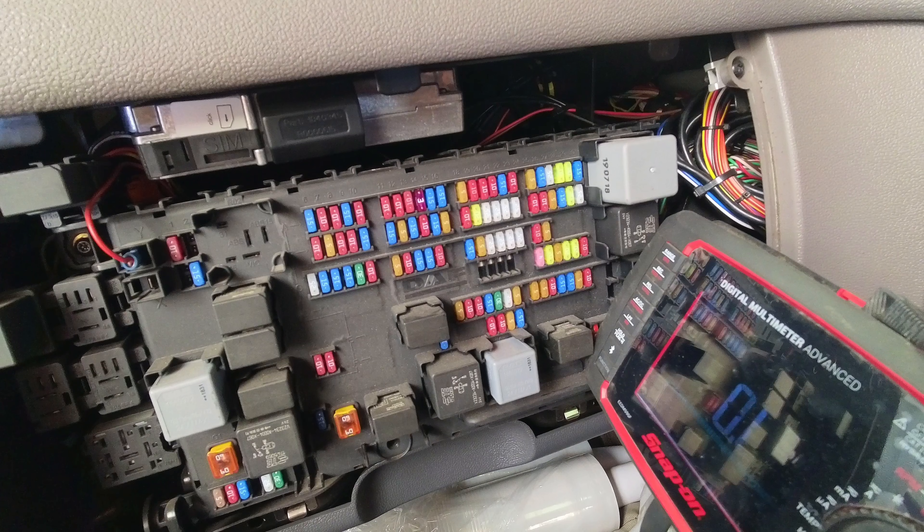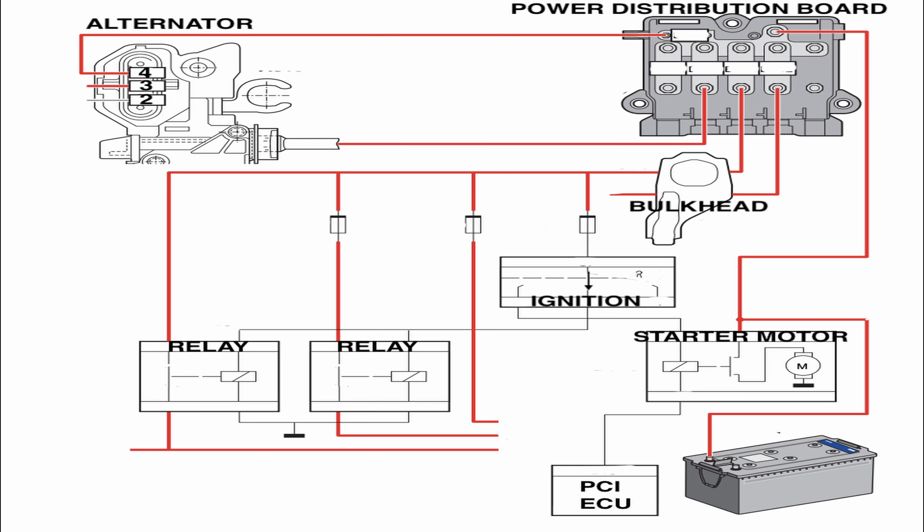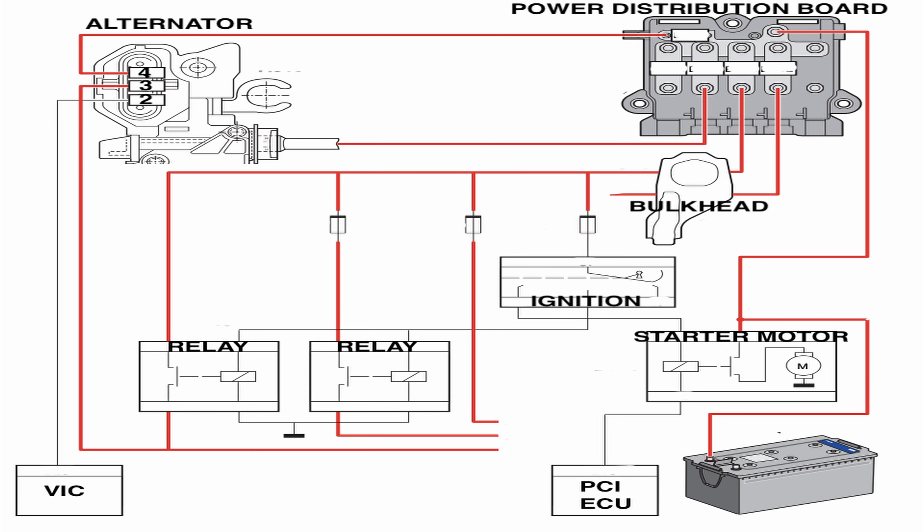Inside the central box we have G015 and G024, which supply power after contact — and as we all know, they're made of chocolate. Last but not least, we have VIC, which connects to pin 2 on the alternator. This is best checked at bulkhead plug 56L16, as this wiring harness connection for the alternator is known to break, putting the warning on the DIP.